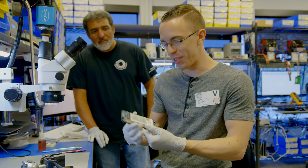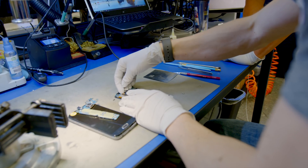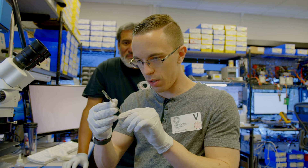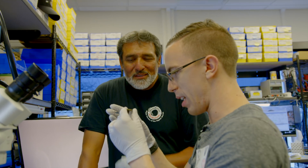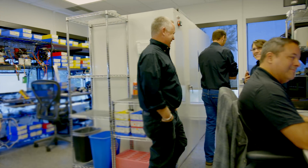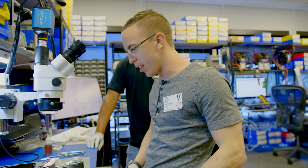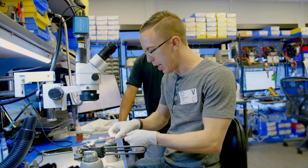Now for the smartphone recovery portion. The victim is a Samsung Galaxy S6. Disconnecting the battery connector, getting the battery out so I don't electrocute myself. We've got our NAND flash — I can see the individual pads. I can see there's a silicone layer in between. A lot of people gathered around to watch this disaster. The phone is disconnected, disassembled, and ready to go. I can see in the microscope exactly what I'm doing. The next step is to take a heat gun, melt the solder, and get the NAND flash off.